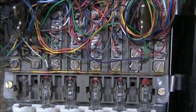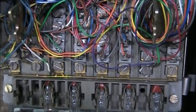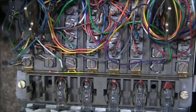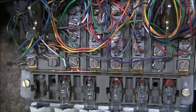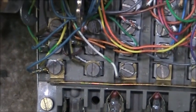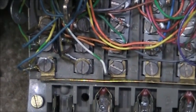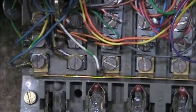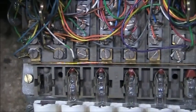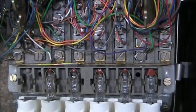One of the differences between a 2564 and a 2565 is the 2564 has a common lamp ground, which in this case has two wires connected to the ground: the white-green, which is lamp ground, and the buzzer, which is also connected on the yellow-green wire, also connected to the ground bus. This is not normal in ITT telephone sets. The difference between an ITT and a Western set is simply the manufacturer, because ITT made both 2564 and 2565 sets.